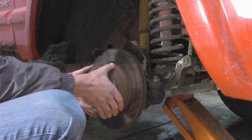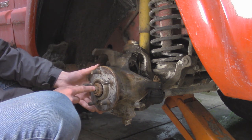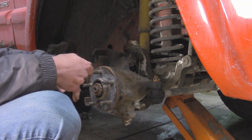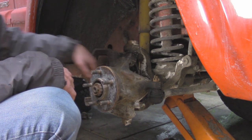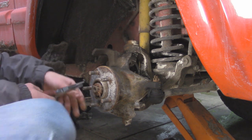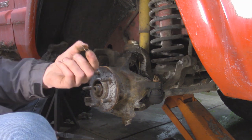If you've done your brakes recently or you have some anti-seize, this should come off nicely — I've done these brakes not too long ago. So we can see our unit bearing right here, held in by the axle nut on the front side, and then we've got three bolts on the back side which are going to be 13 millimeter, 12-point sockets to get those off. To access them, you might want to have your ignition in the run position so you can move the tire back and forth. I'm going to start with the axle nut up here — we've got a cotter pin to straighten out and push through the hole. Then there's a little cap and a spring washer — you don't want to lose that.